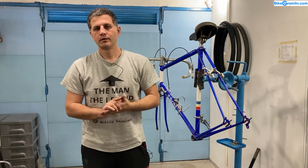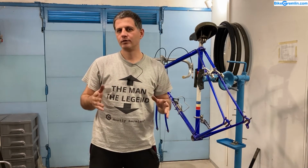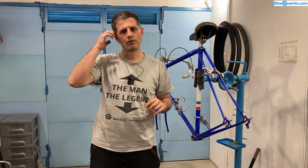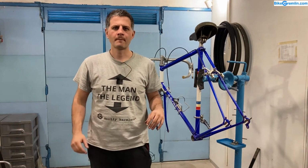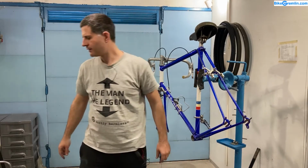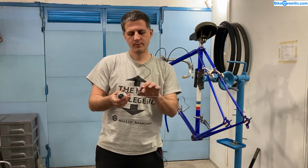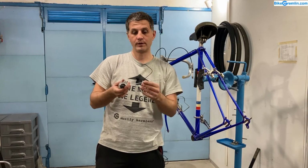And if you are building a set of high quality wheels that you want to be durable and last even for heavy riders, I recommend going with Shimano hubs of some mid-level that are very durable, like Shimano Deore or Tiagra for road bicycle hubs. No need to go any more expensive, you'll get lower weight but not much more durability. And choose spokes that are swagged in the middle, double butted or swagged spokes. They have a thinned down midsection, not by grinding it, but by rolling it in the factory when they are made.